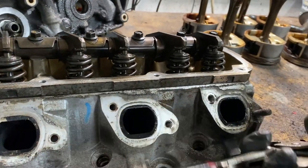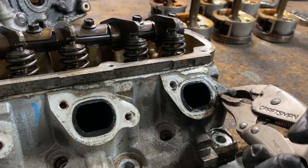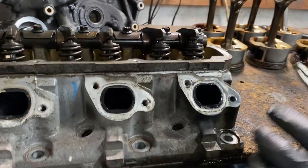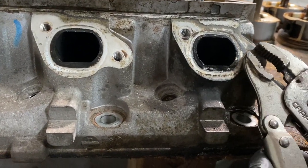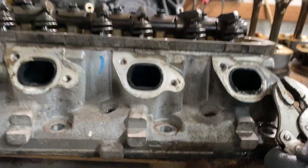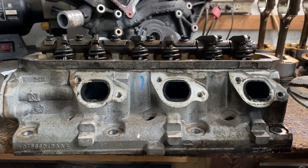The trick is to get it nice and hot so the metal — whatever corrosion is behind it — heats up. There we go, now we got the stud out. What I was trying to say before is you don't want to put the wrench all the way down when the stud is in, because it can scratch the surface. Keep it up just a little bit, lock it as tight as you can, and if it doesn't go the first time, try to wiggle it back and forth a little bit.